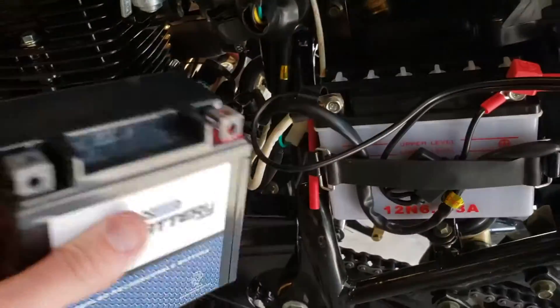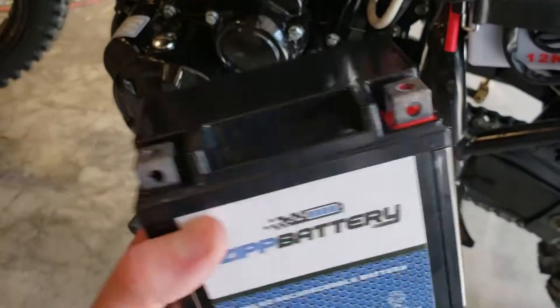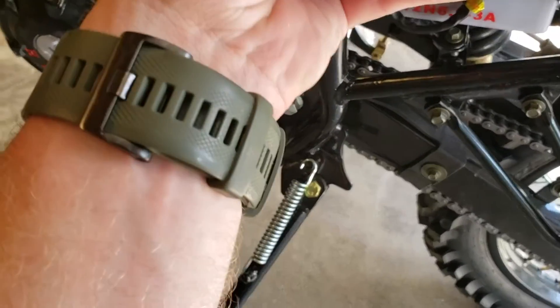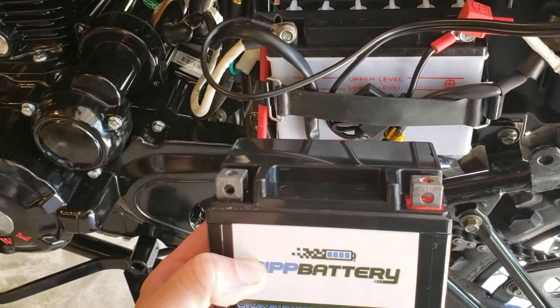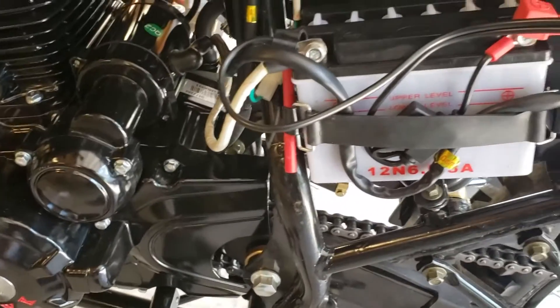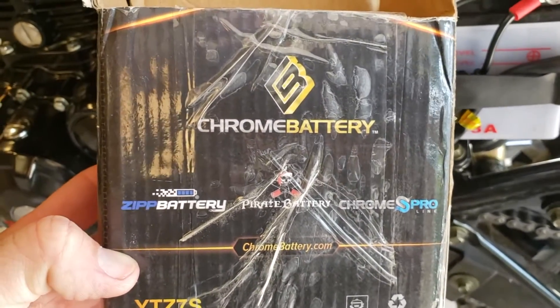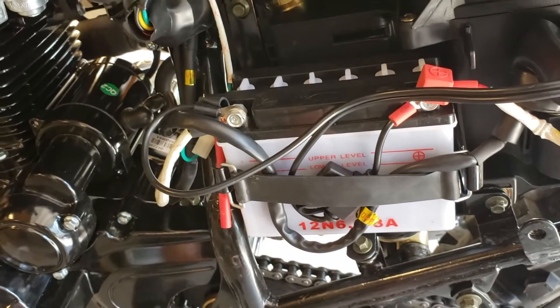A kind of middle-of-the-road solution is a sealed battery like this — no maintenance. These are also known as AGM or absorbed glass mat batteries. This one is slightly smaller, not quite as wide as the battery it's going to replace. The part number for this is YTZ7S — that's the size. It's a Chrome battery, you can get it on Amazon, and it's really only about thirty dollars.